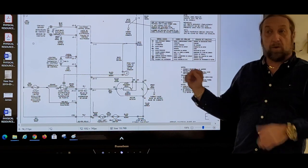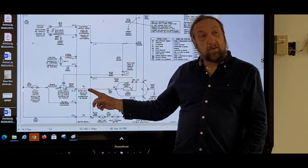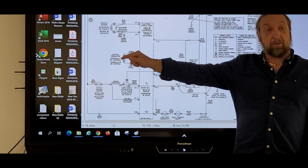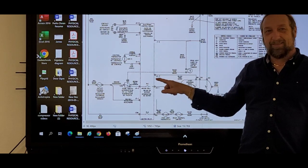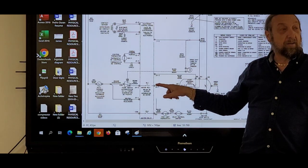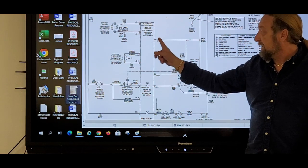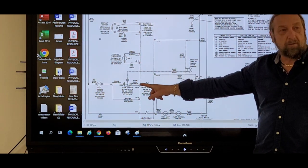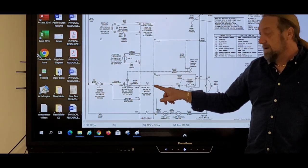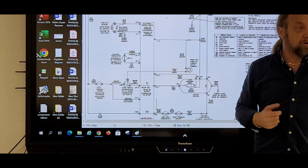It's not the case on this one, but what if I just move the meter lead from here to here and leave the other one on neutral? I press start, what's supposed to happen? It's supposed to close. So what will happen? I'll have what here? Power. Line one and neutral. I'll know if the relay is closing. So if I have voltage here and here, I got power coming into the board. If I move my meter here and I don't have power, I know what? My relay's not closing. That's after you press start, yes.